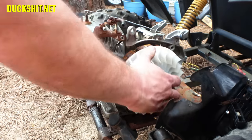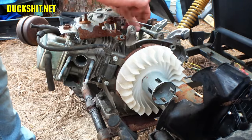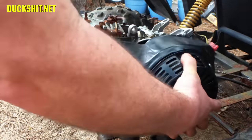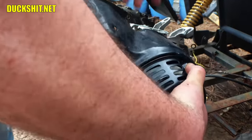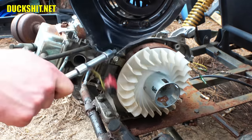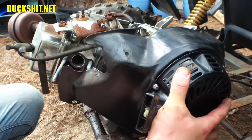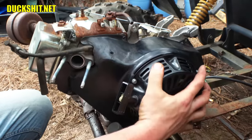It does get compression. It did seem to fire up the other day just fine. This will probably give us a spark now because that wire was touching the frame — that's the reason we had nothing. Before we put anything back together, we gotta put this cover back on. This is our run switch over here. I don't think we're gonna use that anymore — this can actually be knocked out of here. You say, how are you gonna shut the engine off? Well, we're gonna have a proper run switch up on the dashboard.